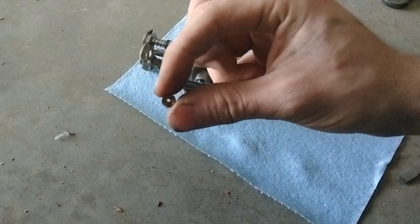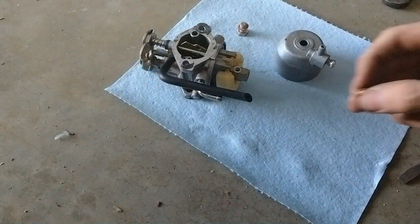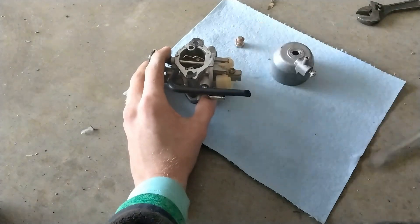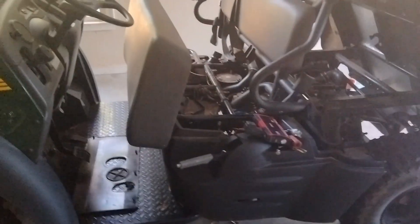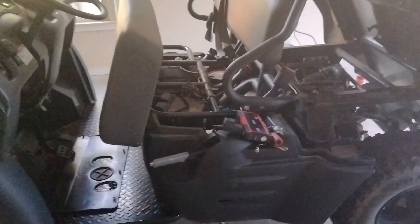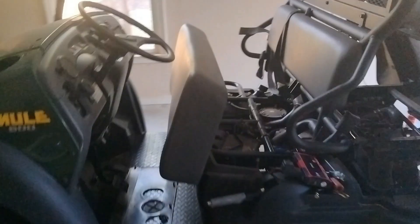I've got the main jet drilled out with the Dremel — the hole is slightly larger. I'm going to reinstall it in the carburetor, put the carburetor back on the engine, and we will see how this thing runs. After putting the carburetor back on, I did start this thing up and it starts up and runs a lot better, but for some reason it's still not idling. So I may need to buy a rebuild kit for the carburetor, but I'll just do that later. The purpose of this video was just to show you how to clean the carburetor on one of these things, and the carburetor was dirty, so I was able to show you how to clean that. Thank you for watching this video — don't forget to like, subscribe, and leave a comment, and I will see you in the next video.